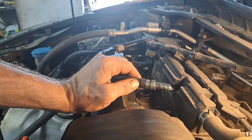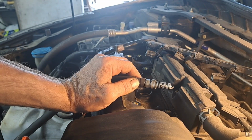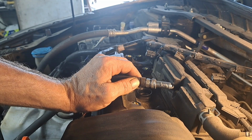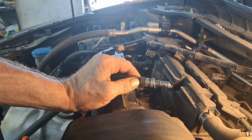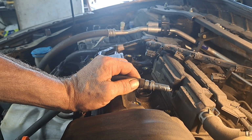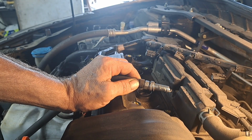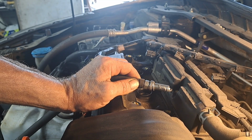This stuff is metallic. I'm just letting you know this stuff is metallic. It's not to be used for boot grease, for anti-seize on spark plug boots or your coil packs. That's a big no-no. Being it's metallic, it's a conductor. In other words, you'll provide a path for spark to go down the side of the spark plug with least resistance and ground out and cause it to misfire and arc down the side of the porcelain and ruin it. So you don't use it for boot grease.